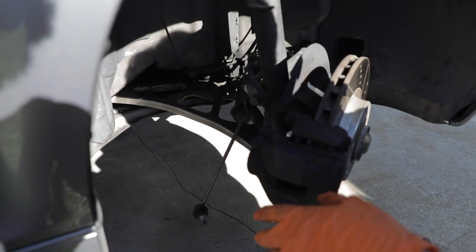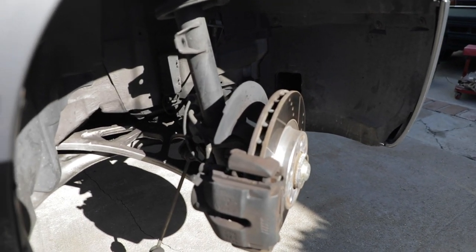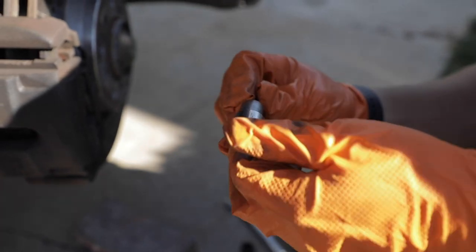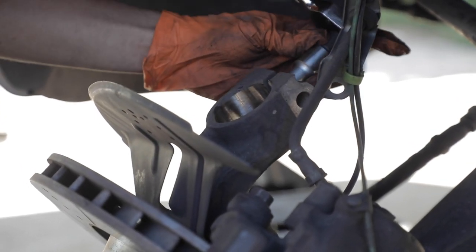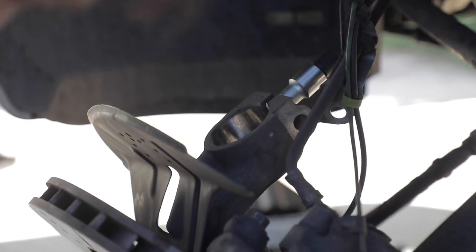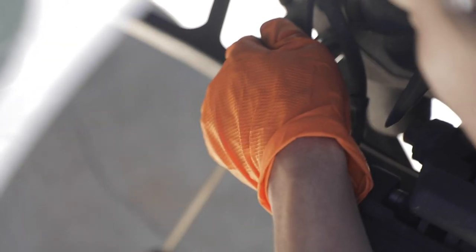While it can be kind of tough and you can use a pry bar to spread it, I opt to use this tool. I believe this is called a European knuckle spreading tool. I bought this from ECS Tuning. We'll link in the description down below. Essentially you put this in between the space back here. It's going to be hard to see, but there is a space where my finger is, and you line it up and use a ratchet to twist it so it can spread the knuckle apart just enough. So when it's spread enough, you can push this down. This might be kind of difficult for some people, especially if your car's been in the East Coast with winter salt and all that.